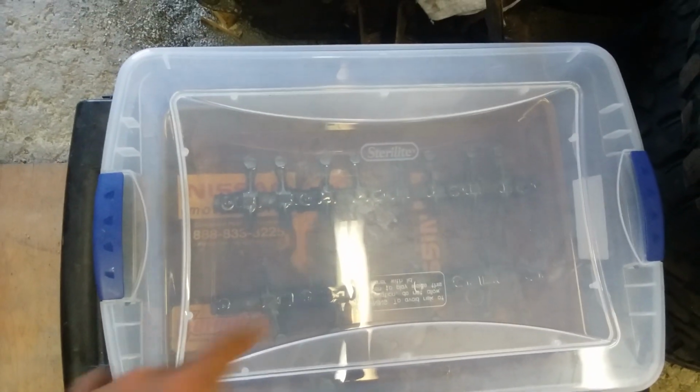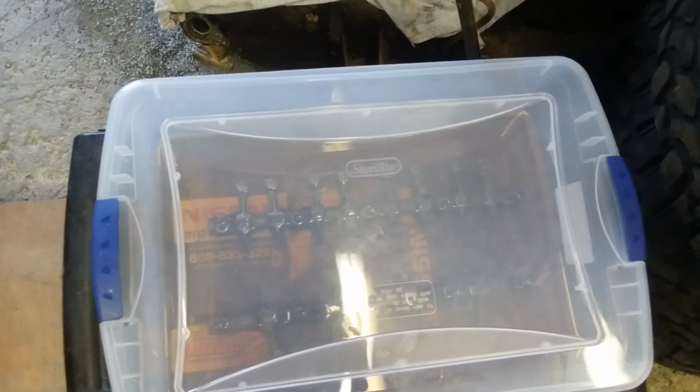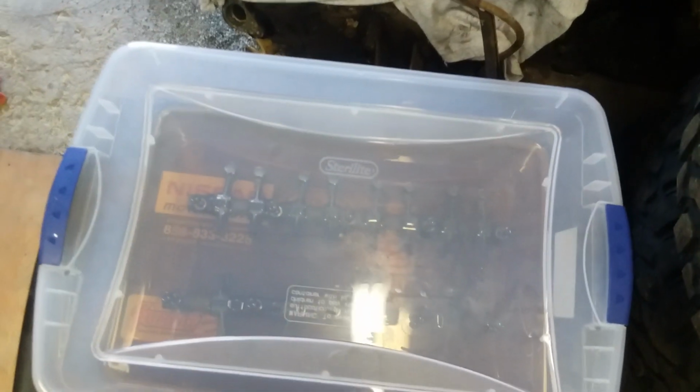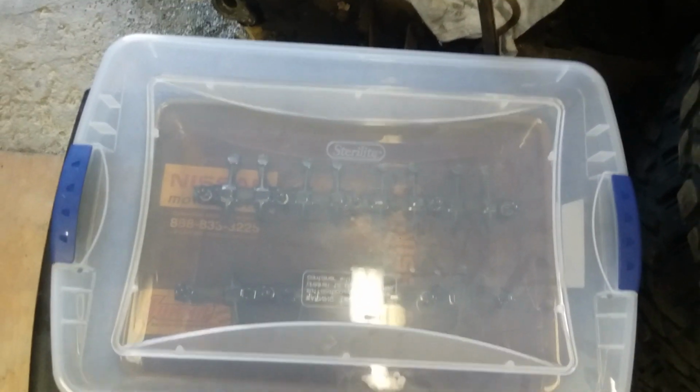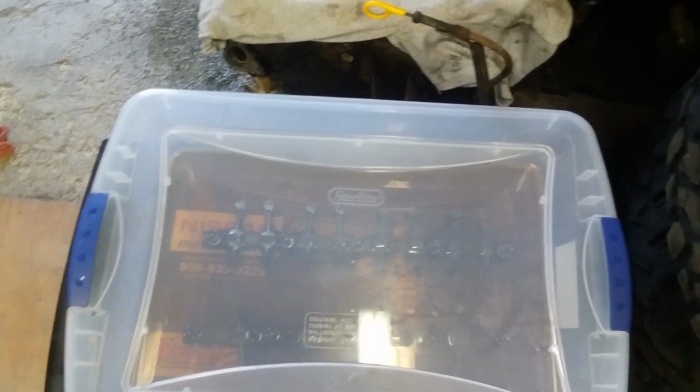I tanked those for like 6 hours just to try and get any kind of caking or anything out of it. That's my problem. I think I have sludge going on somewhere, or a piece of debris is going through and has clogged these rocker arms. If you look at these rocker arms closely, by the way, let's take this example right here.